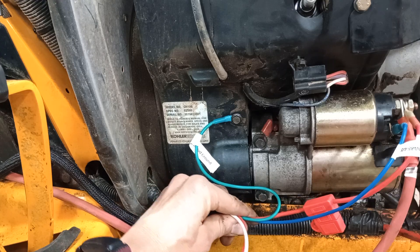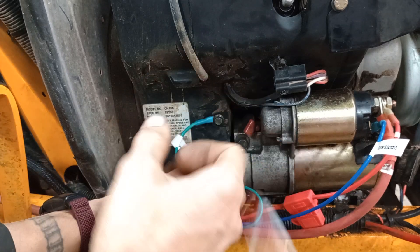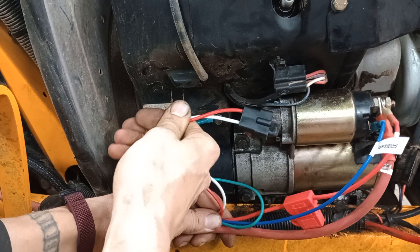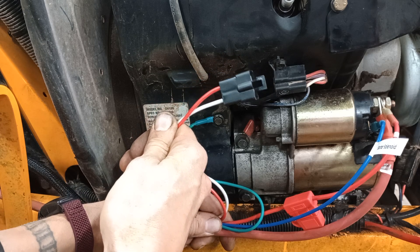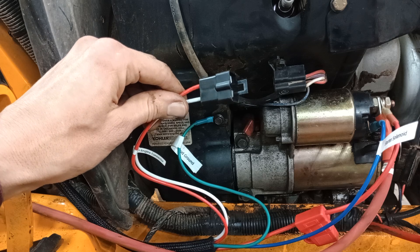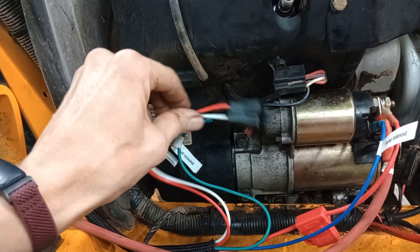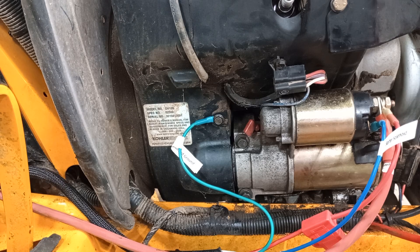Now you've basically got those circuits connected including your main positive wire, so everything's ready to go. The next thing to do is just plug in your engine connector. This one won't plug into this engine because this is a five pin going to a four pin, but basically at this point it's plug and play — it will match your engine connector based on what you specified. It's a really simple install, there's not much to it. As long as your key switch is hooked up, go ahead and hook your ground back up to your battery and fire up. That's the bare bones harness — let us know if you want one or if you have a specific modification of harness for cub that you'd like to see us make. Thank you and we'll talk to you soon.